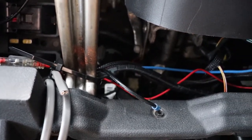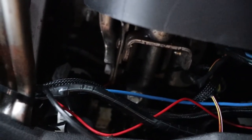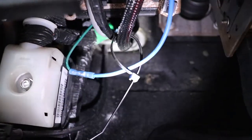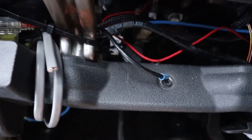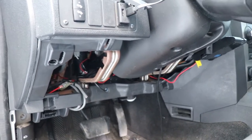The red wire for the stop lamp switch is pretty close to the steering shaft, so make sure it doesn't get bound up around your steering. I've got the blue wire tapped on, with zip ties on loosely for now because the tops of the brackets are very sharp — I need to put some protective material over them before tightening. At this point we are done inside the cab of the vehicle, other than putting the trim pieces back on. Now I'll move out to do the ground and put the breaker on the battery.